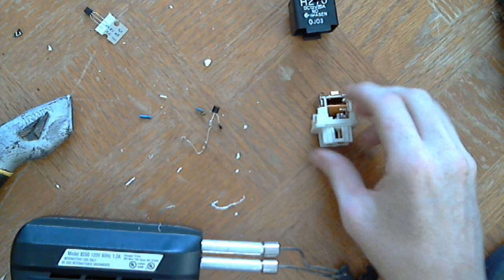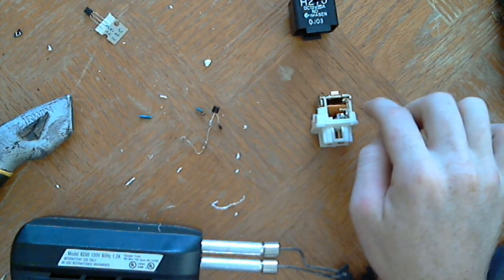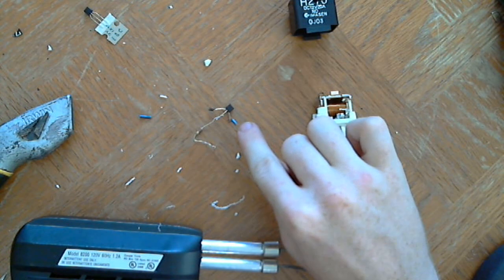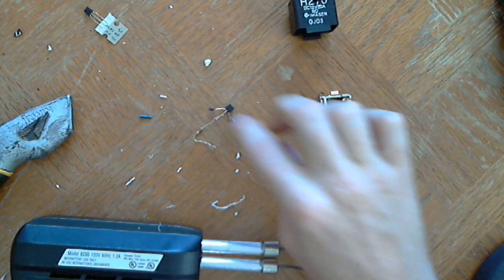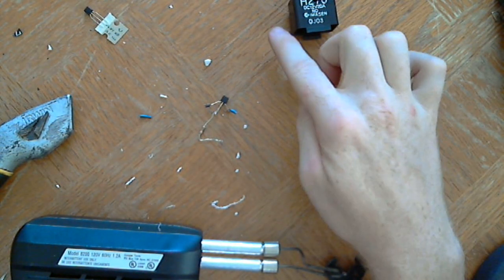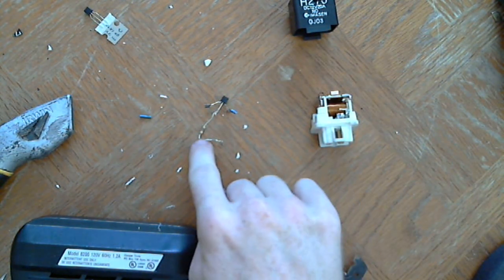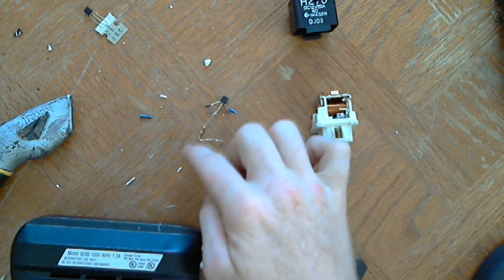The wire will be branching off after it's soldered on here, and it will go to the tachometer, and it will also go to this side of the transistor, which is the collector side. So it's going to wire into the collector side of the transistor, and between here and the relay coil, there's going to be a wire that goes off to the tachometer. This middle pin has the resistor in line with it, and that's where you would wire the potentiometer I'm talking about, or in this case I have a 1,000 ohm resistor wired.